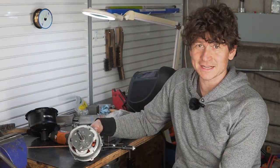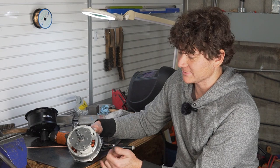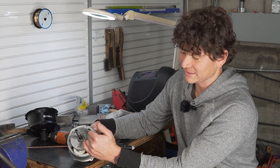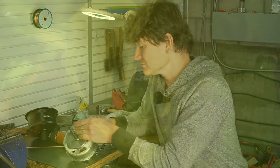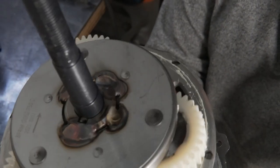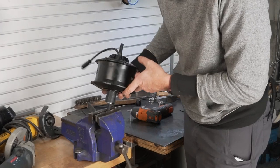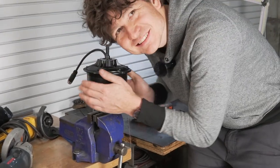This is really identical to the Sheng-Yi motor but even easier — there's no o-ring to remove from the axle. All of these clutches have a similar look: a metal plate that spins and a central collar tied to the shaft via keystock. We simply tack weld the spinning plate to that collar so it can no longer spin. Once again not the prettiest thing, but that looks like a weld that'll hold up. We put it back together and do the spin test — it's good.